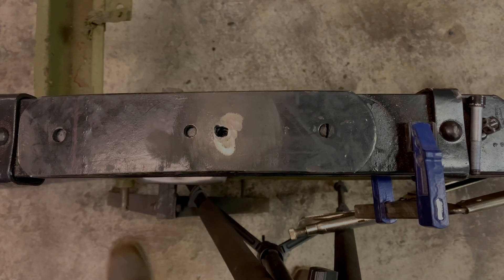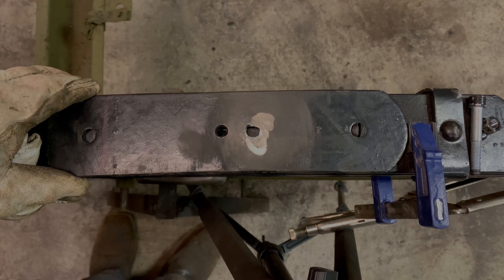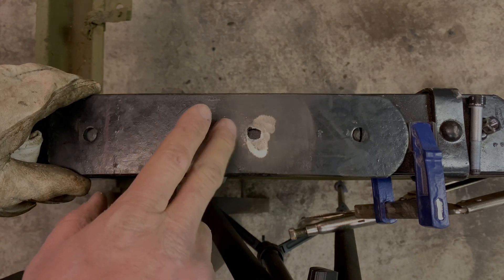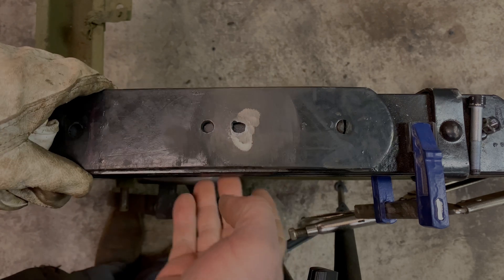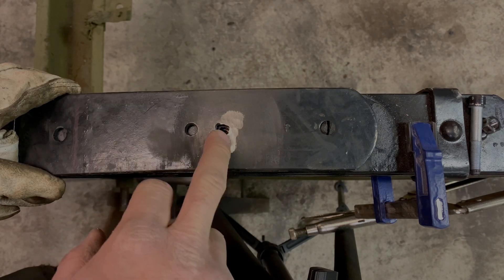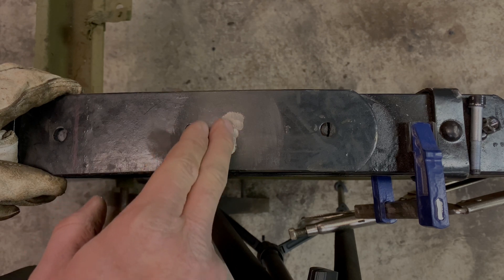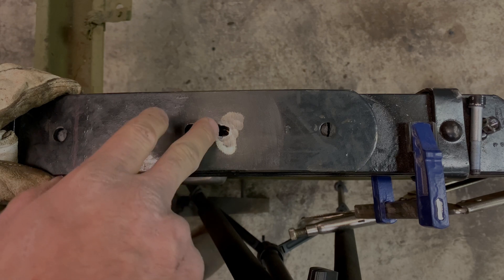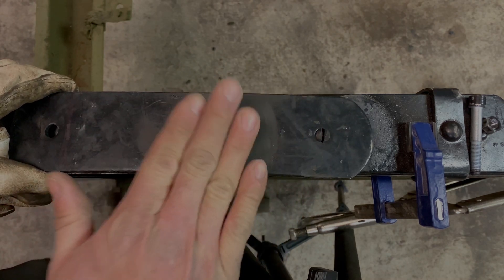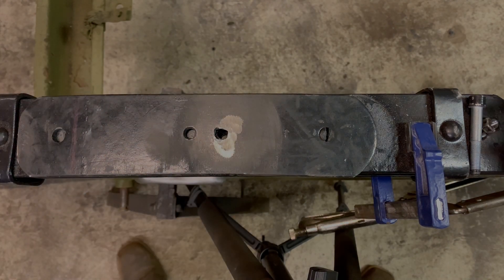I moved the pin one inch from its factory location — that little movement is fine. You don't want to put extra holes in your main leaf or any of the more important springs in the pack, but the smaller leaf at the end doesn't do much. A good way to make a hole in spring steel since you can't drill it — it's too hard — is to use a torch. Make sure you've got a good sharp clean tip, put it right against the steel, wait till it gets hot, and blow it right out. Don't play around too long because it is a tempered material and you can take the temper out of spring steel.